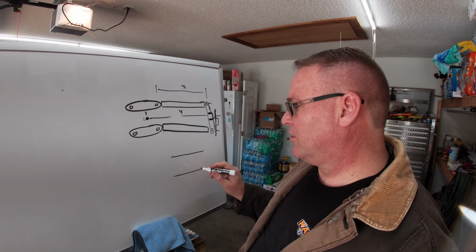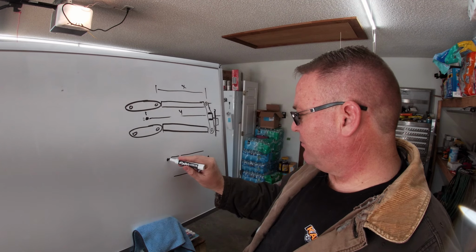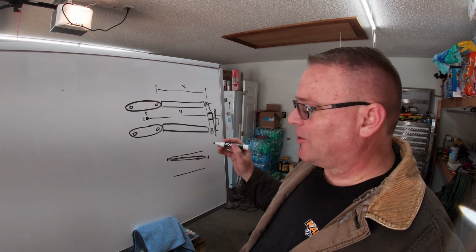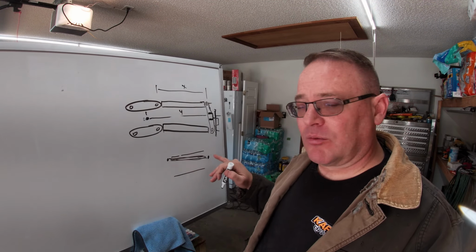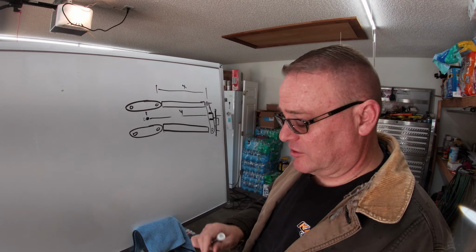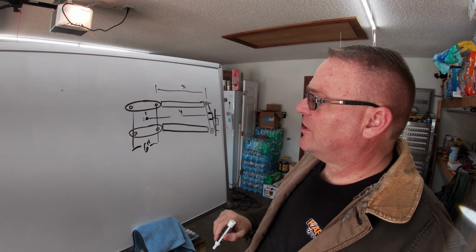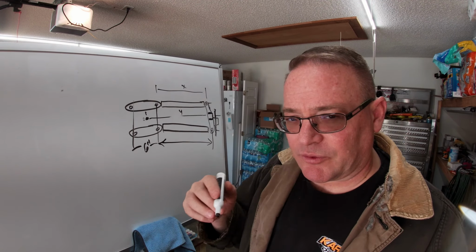This is my upper and lower, and I have it way up here, but down here is where that is. That will make it longer as well because it's a hypotenuse thing, a squared plus b squared equals c squared. Because that is longer, that will also affect it. So I'm trying to match my tie rod length to the arm length as much as possible. In my perfect world, since these are 6 inches, right? And then this would be whatever that was. It was like 24 and a half or something like that.